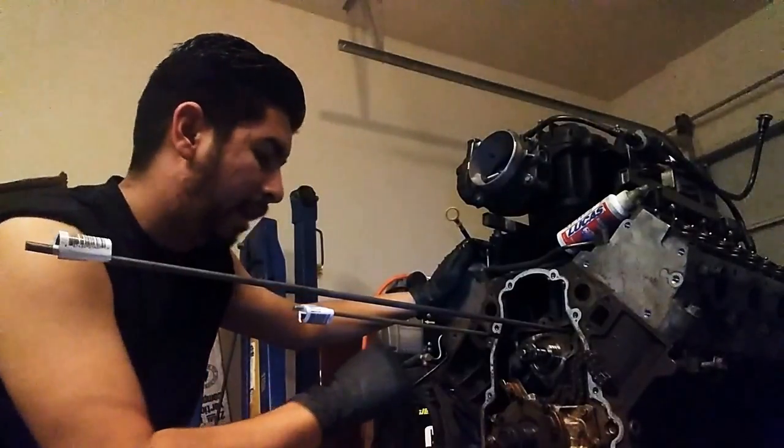I do have my cam sitting prepped up. I used some Lucas assembly oil — I have it right here for when I put it back in. I at least have the farther back part of the cam lubed up, so when I start putting it in there, I'm going to put it halfway in and then lube all of that up. Let me start taking the old one out.